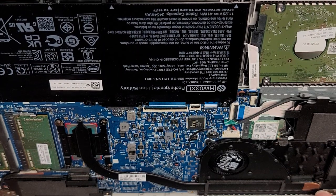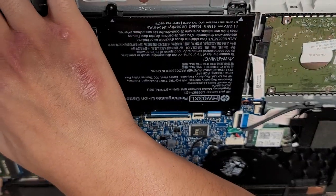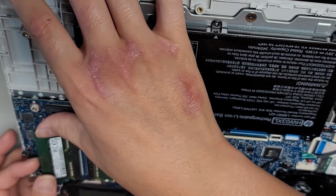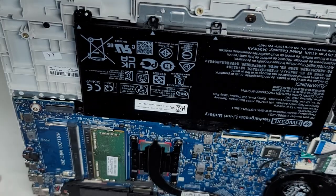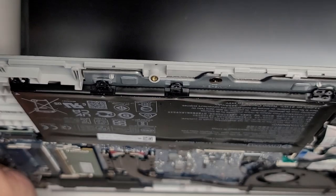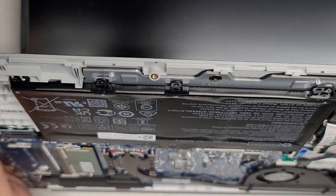Sadly, it seems like the motherboard is toast. Still nothing — it shouldn't take that long, so I'm going to force shut this off. I'll pull out a RAM stick just in case it's a RAM issue, since this RAM was closest to the liquid spill. Maybe that's also part of the problem. Let's power it up again — I doubt that's the issue, but we'll find out.